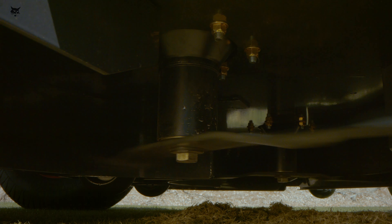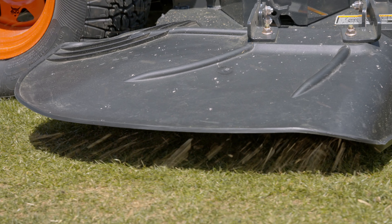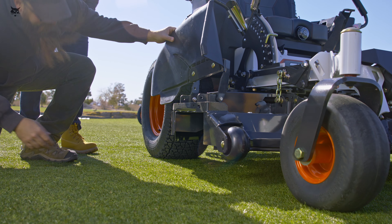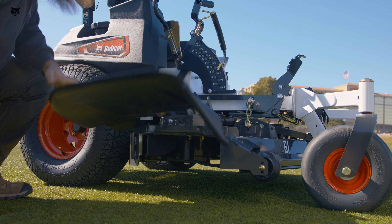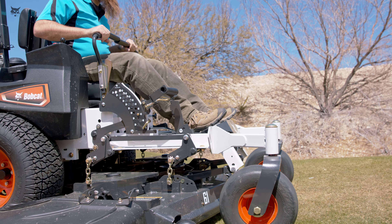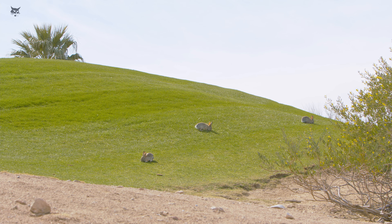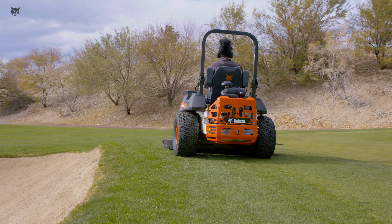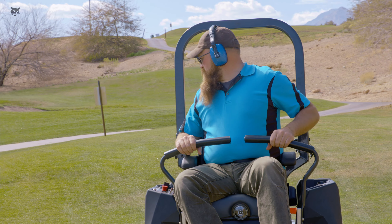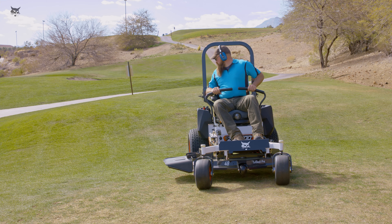It is important to know the direction of the mower's discharge chute. Ensure that the discharge chute is pointed in a safe direction. Do not mow with the discharge shield raised, removed, or altered unless there is a grass collection system or mulch kit in place and working properly. Be aware of bystanders and animals while operating the mower. Children are especially drawn to these machines, so make sure there is another responsible adult keeping them away from the mower while in use. Check behind you when backing up, and do not mow in reverse unless absolutely necessary.